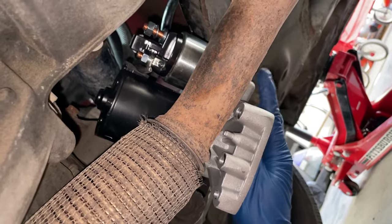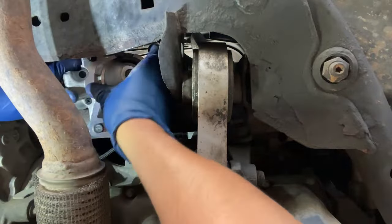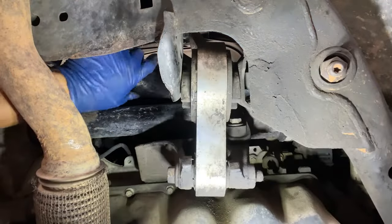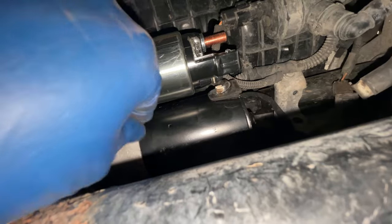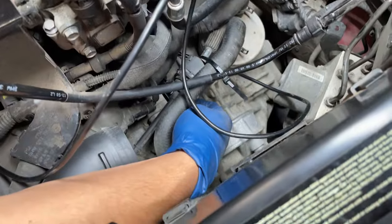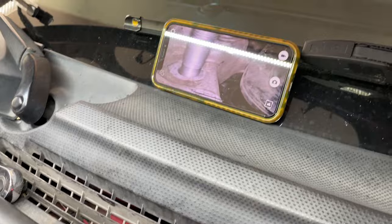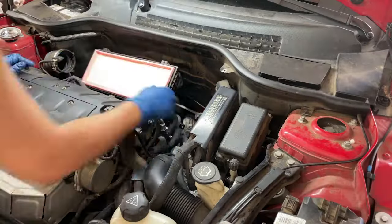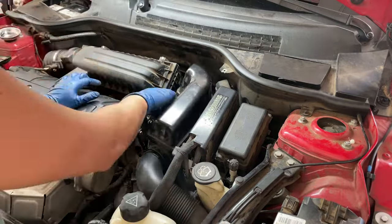You'll have to pull on the exhaust a little bit. After you've placed the starter where it goes, you can place the bolts and start to hand tighten them. Replacing the top bolt can be a little tricky, but use the same two wobble extensions to help you get in there — I used a small video camera for guidance, but you can use a mirror. After you've adequately tightened all the starter bolts, all you have to do is reassemble everything back together, and don't forget to reconnect the negative terminal on the battery.